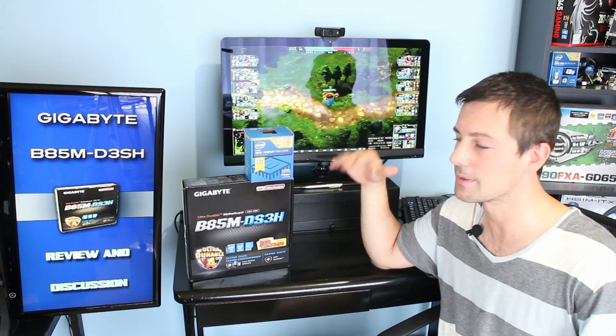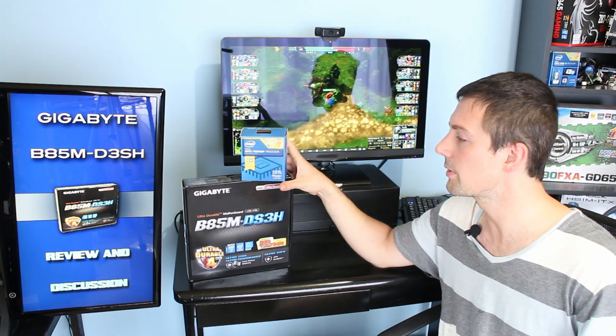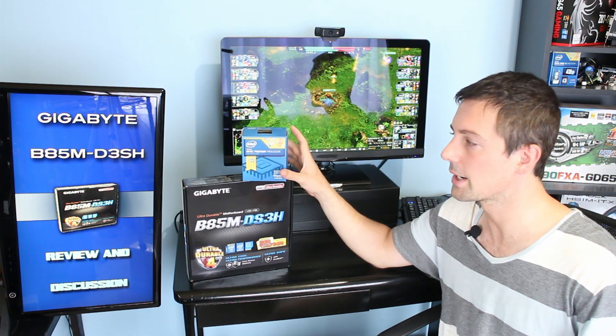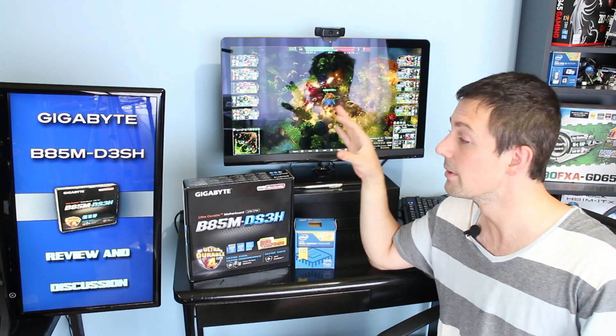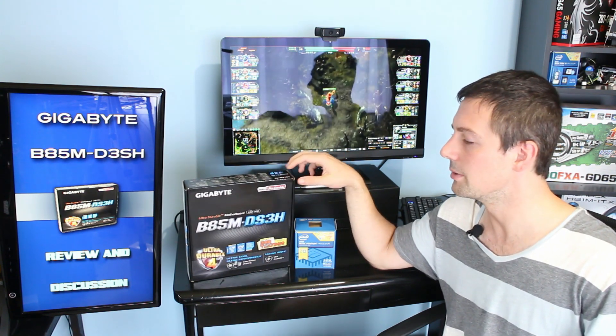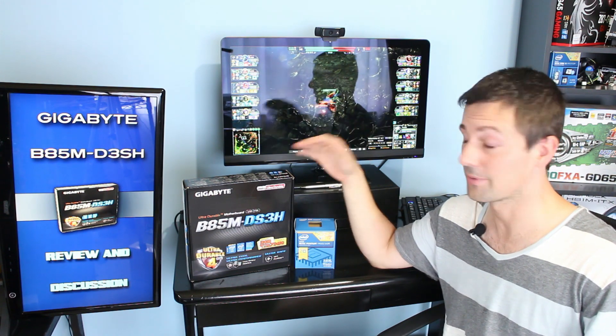Once you update, you can put the voltage up to 1.2 volts, which is how I'd recommend overclocking — set it to 1.2 volts and see how high a clock speed you can get on the 3258. I also raised the TDP limit and max wattage limit so it wouldn't become an obstacle. The reason there's a 1.2 volt limit on the B85 is simply to protect the motherboard and the user from frying it, because a fried motherboard can damage every component in your system. I agree with this limit — it's a good safety measure, especially since these boards were never intended for overclocking.